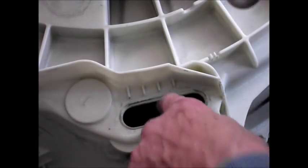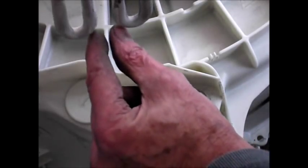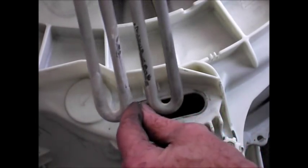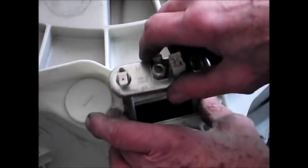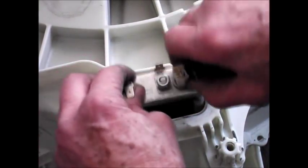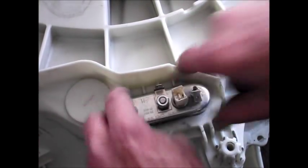When you look inside the tub, you'll see there's a clip which goes inside these two parts here and holds it in place. When you put your heater back in, make sure that you get it in that clip properly, otherwise you could damage it on the drum, or you could melt the tank.